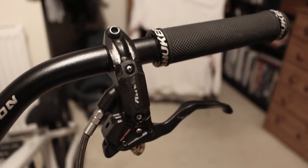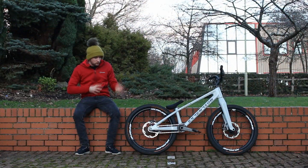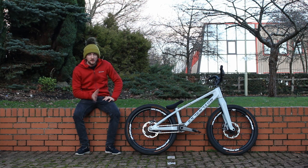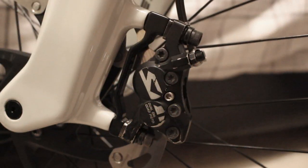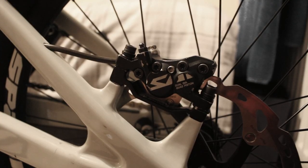I love these brakes, I've had them years. I've actually got a box of spares which I swap through to try and keep these brakes going. I'll probably end up upgrading to some new Shimano brakes when these die, but they're still really good. I'm running red EBC brake pads with Shimano XT Ice-Tech rotors — really good. I'm running 203 on this bike and I've had to use some brake adapters, just a plus 20 post mount because the frame and fork both have post mount.